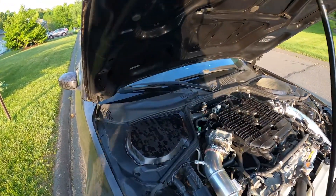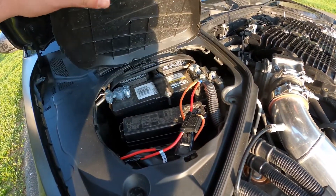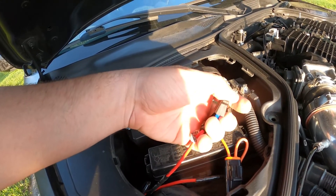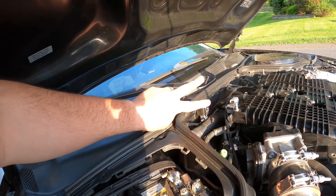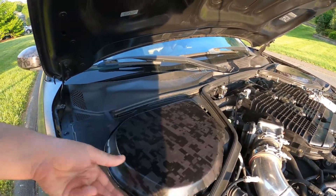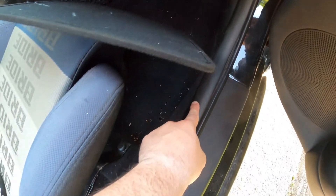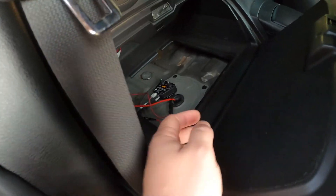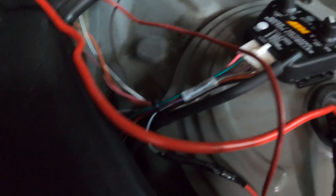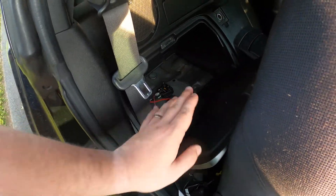It got really dark during the install so let me recap. We attached the solenoid here — drilled two holes and zip tied it. Under here is the battery tray, and we added a fuse connection there. The solenoid has two black wires: one comes up and gets attached to the battery itself down here, and the other wire we had to extend — we shoved it through the firewall, fished it under the carpet and up through here, and it gets attached to the AEM meth controller. There's a brown wire with a white stripe that comes off the controller — you attach the black wire onto that. One black wire goes to the battery, the other goes to the controller — easy as that.